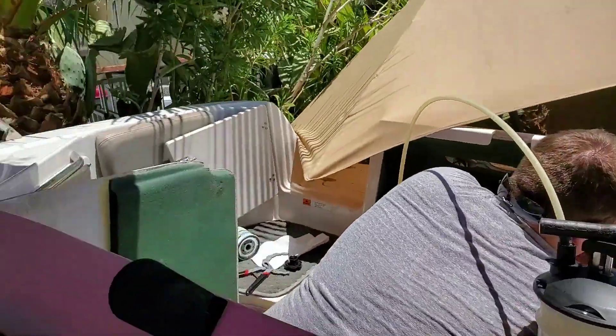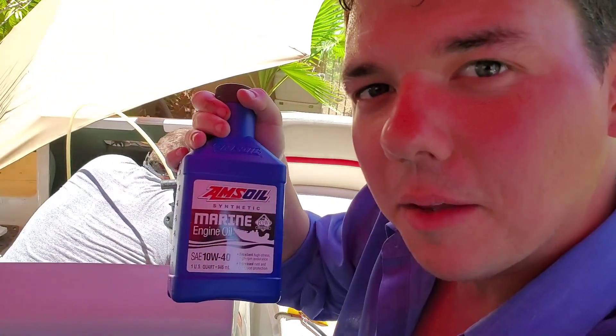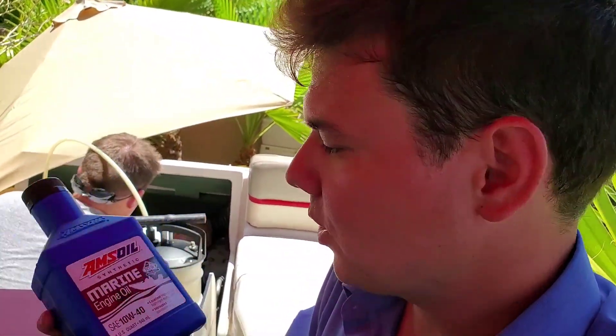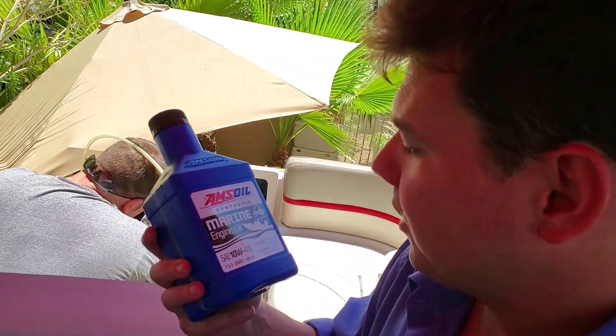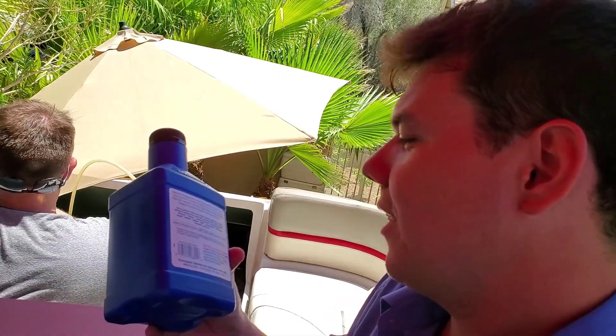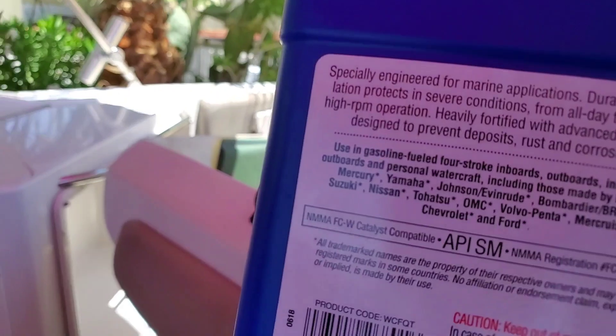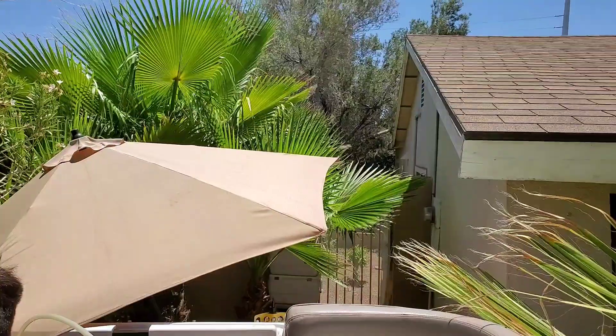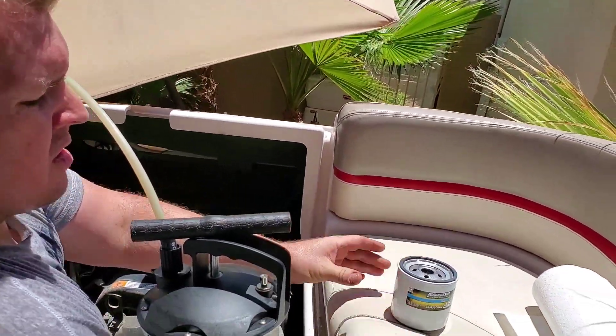We got her off — it was a killer but we wore it out. Now we're going to lube up our fresh filter. We'll be putting in the 10W-40, which is a great intermediate weight — not a race engine 50 weight, not a super gas-mileage 30 weight. This is right in between, with tons of protection. This is actually the original viscosity AMSOIL came out with back in 1972 — the API certified 40 weight, the very first in synthetics. It meets and exceeds all API certifications and will not void any of your warranties.